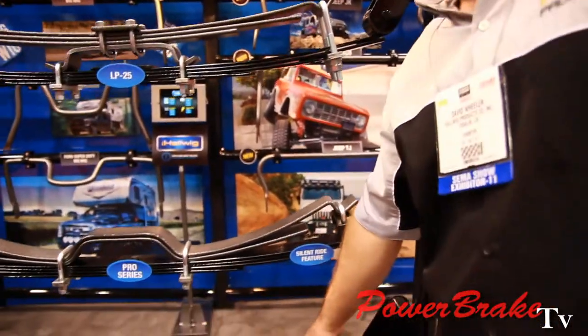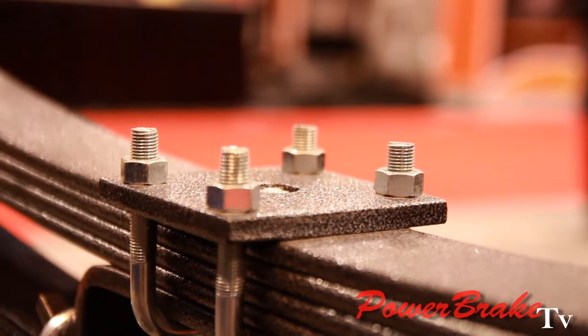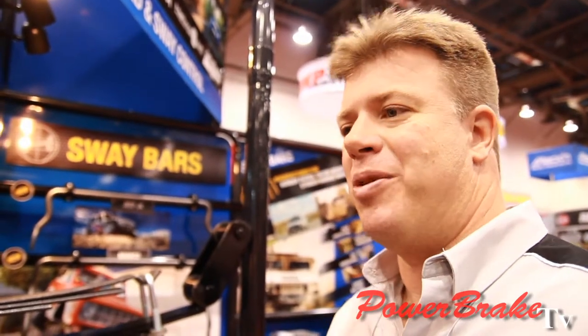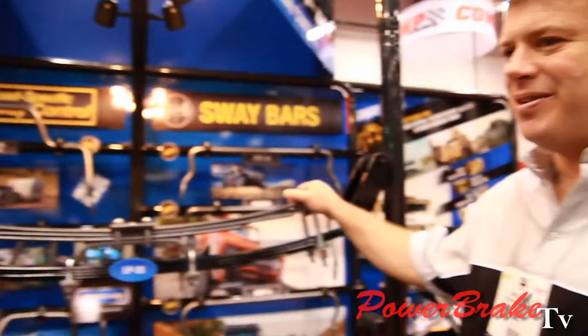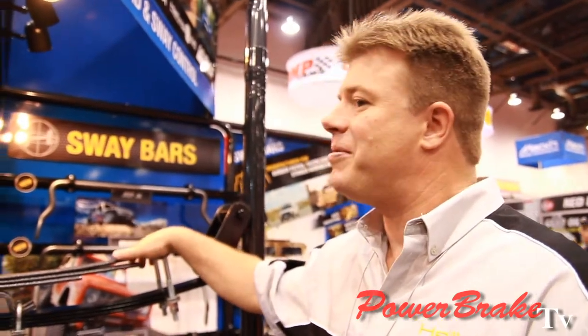We also have our Bigwig LP35s for serious tow-and-haul applications. This also kind of acts like a rear sway bar by stiffening the leaf spring — by increasing spring rate, you're going to stabilize the vehicle against sway. But a sway bar is the most effective way to control sway because that's what it's designed for, and it doesn't affect ride quality — it only comes into play when the vehicle tries to lean. Some people don't want the hassle of running a compressor and a tank; they want the reliability and set-it-and-forget-it nature of a helper spring, so these are still a popular application.